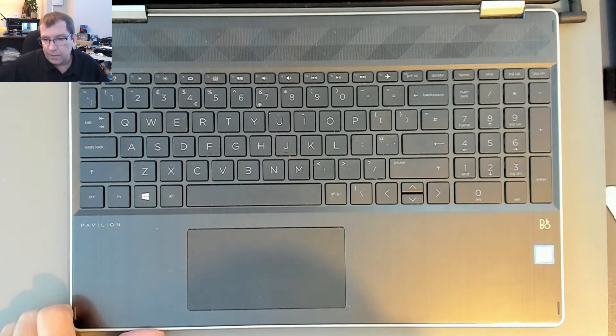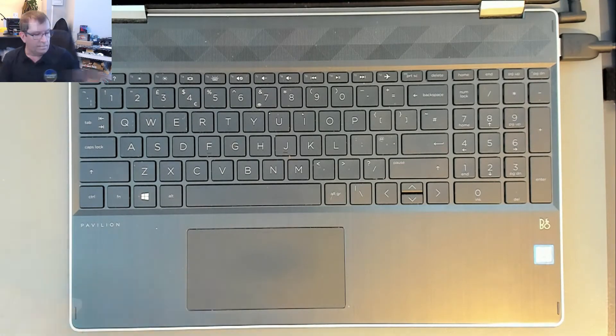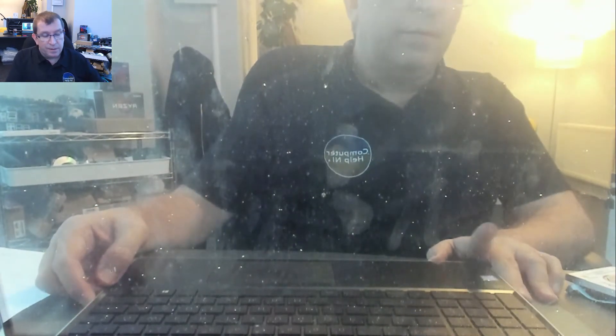Yep, it's booting into Windows. Let me just get the HDMI going. So this computer is booting almost into Windows and then getting the blue screen of death. I'm trying to coax it into automatic repair mode by starting it and then killing the startup during the Windows wait cursor. If you do that three times, on the third time it should go into Windows recovery tools.